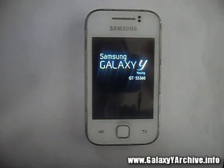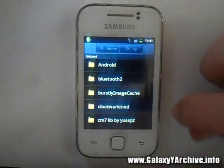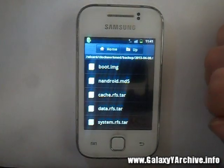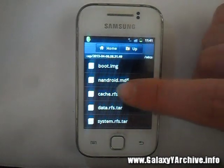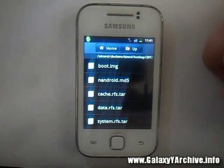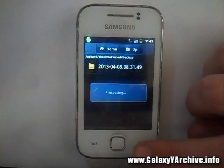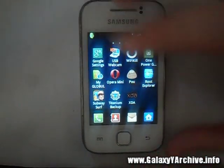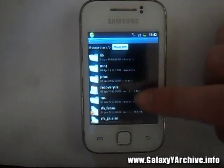For this next part, go to your SD card files. You should see a folder called 'clockworkmod,' inside a folder called 'backup,' and inside another folder named with the date when you took the backup. Inside we have compressed files which contain your phone's data from the backup. The file we are going to modify is 'nandroid.md5.' You can modify this from your computer by right-clicking, choosing 'Open with,' then Notepad, and deleting all the contents. If you want to do this from the phone, you'll need an app like File Expert or Root Explorer.